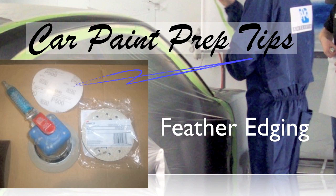To do feather edging, we're going to use a DA sander — a dual action sander — and 220 grit sandpaper. We don't want to use an interface pad for feather edging, because feather edging is basically the process of leveling out paint surfaces, and a harder surface works better for leveling. The interface pad is very soft, so it won't work well for that. It works well for final sanding when we don't want DA edge marks digging into the paint. For feather edging, just use the DA and sandpaper — that will level out the feather edge better.